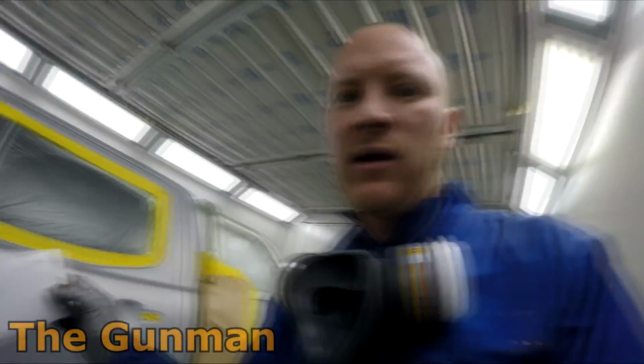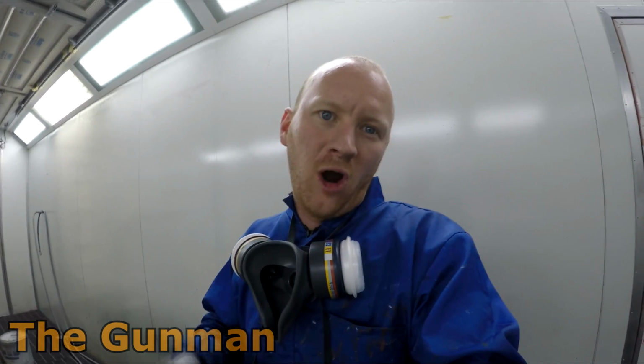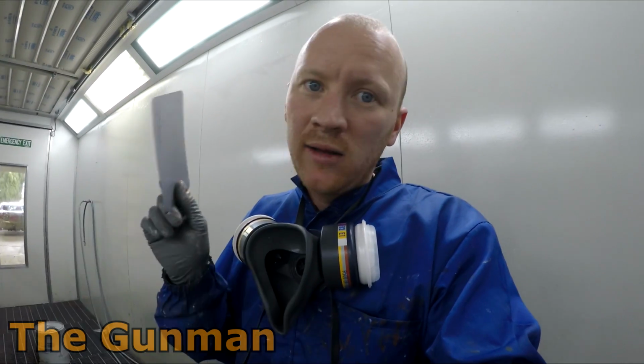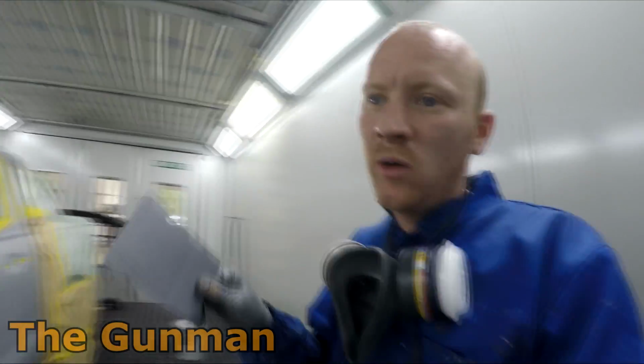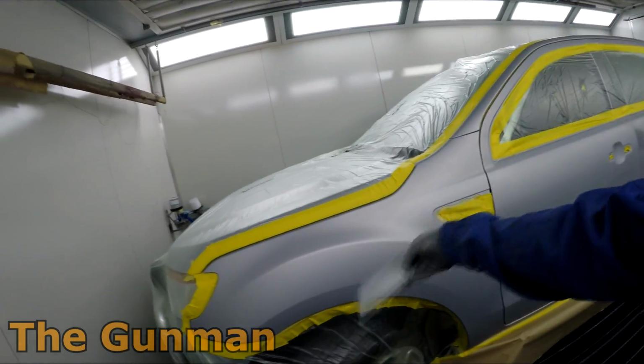Now, this is one thing I wanted to point out to you guys: previously, all I was doing is a 1.5 coats application, which is what the Cromax and Axalta guys will tell you. They'll say every single colour, 1.5 coats, you'll get your coverage. In the real world, that doesn't work. So I was doing funny blends. I had some blends that were sort of turning out a little bit dark, and you get these funny halos